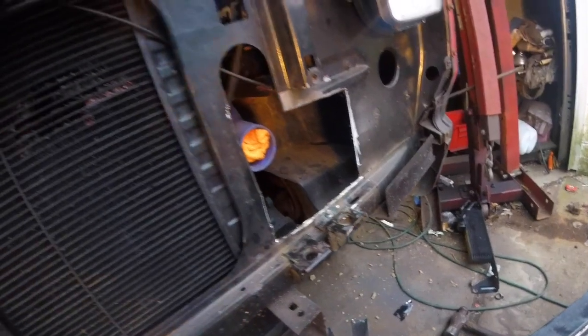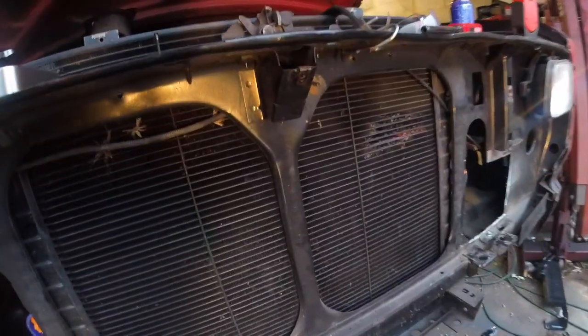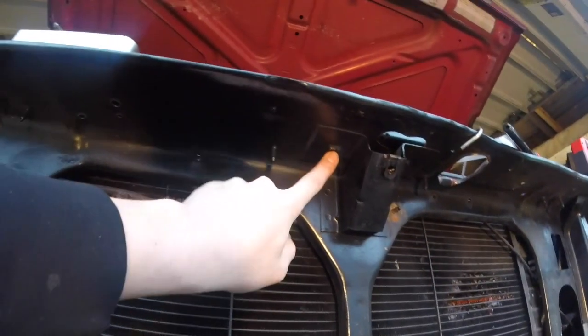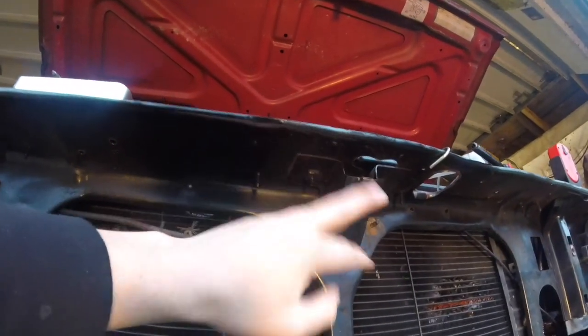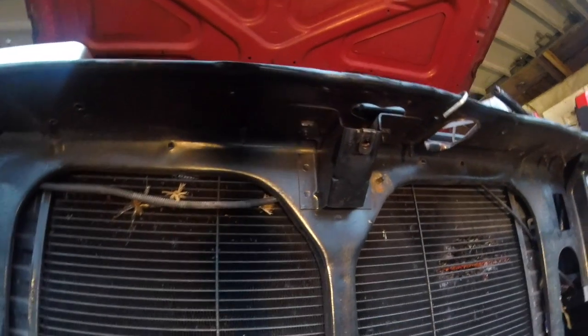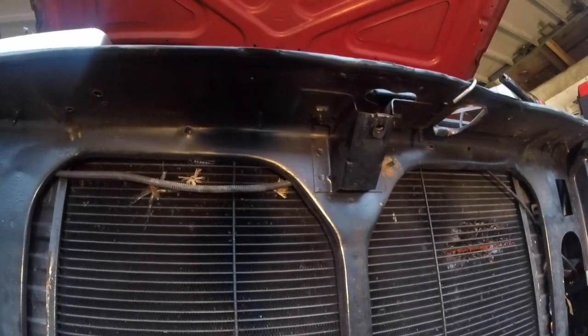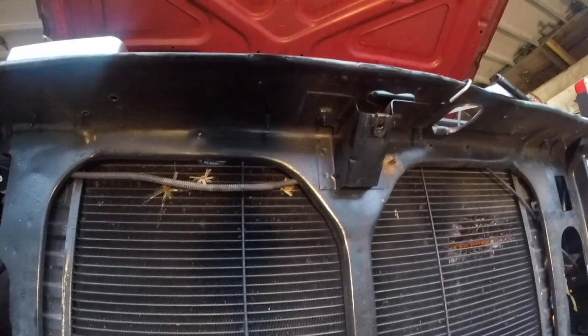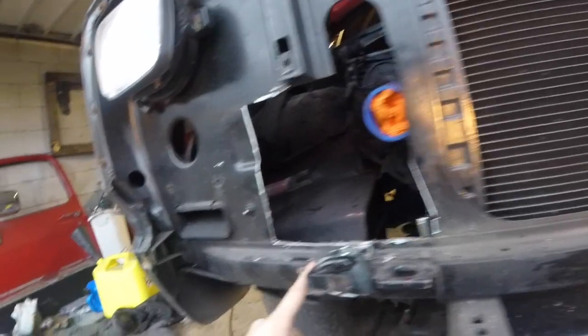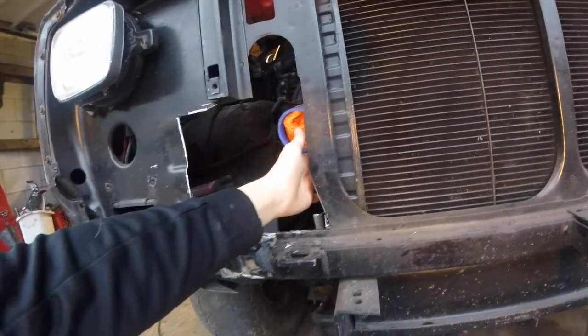They're self-tapped on both sides and it's in the right spot. I'm going to cut this piece completely out because we don't need it, though the hood latch does bolt to it, so I'll cut it even there and tack weld if needed. I might make my own L-brackets down here to support it. Once we cut that out and figure out where it sits, I'll chop these off, tack weld them on, and then move on to the radiator portion.